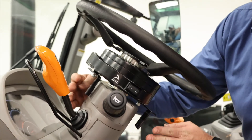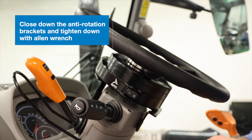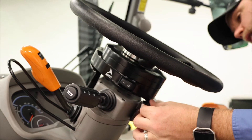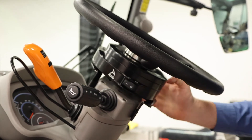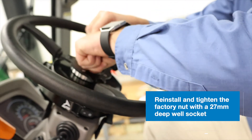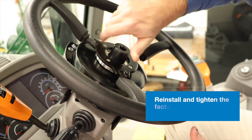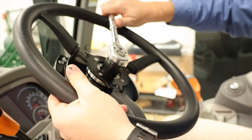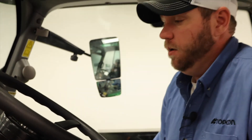With our anti-rotation brackets positioned for this steering column, we're going to close them down as tight as we can around the column, then take our allen wrench and tighten up each allen screw, making sure everything is good and tight using all the supplied hardware and ensuring all lock nuts are in place. Once we get all those on and tight, we're going to take our factory nut, drop it down into the column, get it started, take our 27 millimeter socket, slide it right down in and tighten it up. Now our steering wheel is mounted to our column.